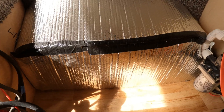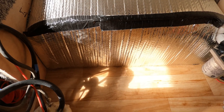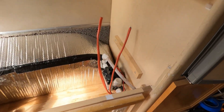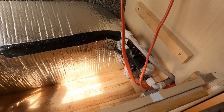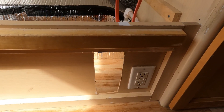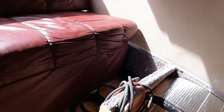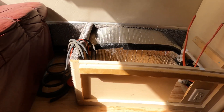This box is waiting to hold the inverter and the DC-DC box, and those two components could give off quite a bit of heat — they have fans in them. This box was originally a storage bin; it has the water pump in it already. Sandy and Wei have cut out a ventilation hole on this side, and they've also cut another ventilation hole up there. Sandy's bought a really nice grid covering to put over top of it so it will finish it off nicely on the inside.